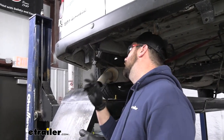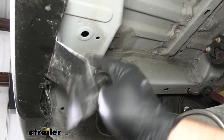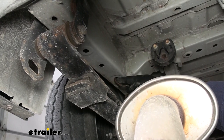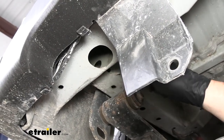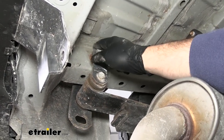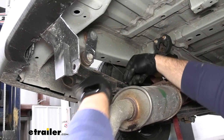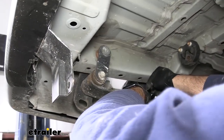Next we're going to be fish wiring our hardware through our frame. The three holes on each side that you're going to be using for your hardware are this hole here — underneath this plastic tab that we just pulled down — this hole here, and this hole. There are two different ways you can run your hardware: one way is to widen this hole to 7/8 of an inch and run your hardware up inside these two holes down and out, or you can take your fish wires and run them from this hole over top of the shackle for your leaf spring. You have to go over top because underneath is too small for the head of the carriage bolt to fit. We're going to do this method because we already did the passenger side and it worked out great.